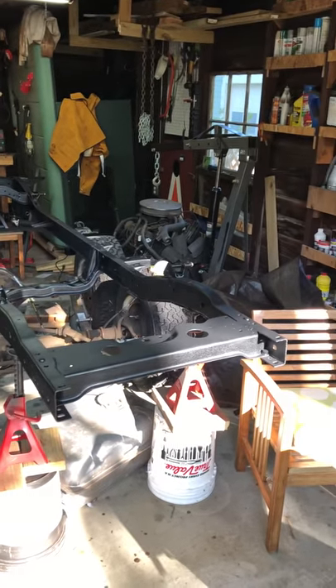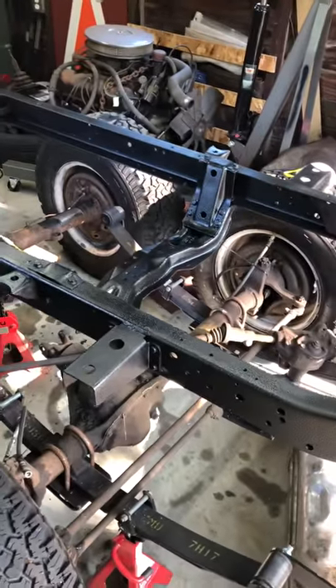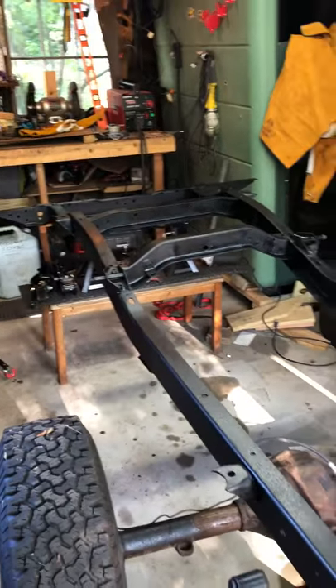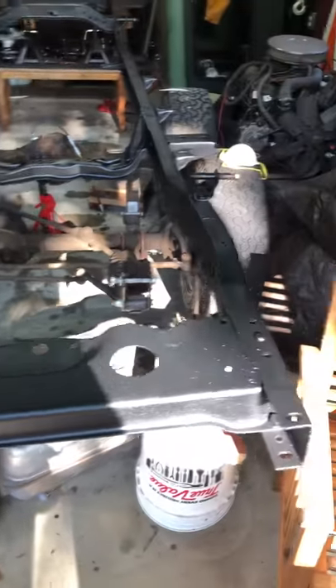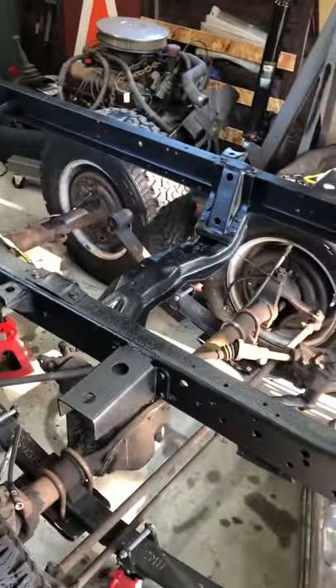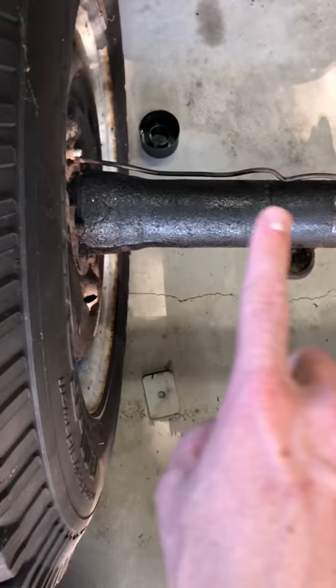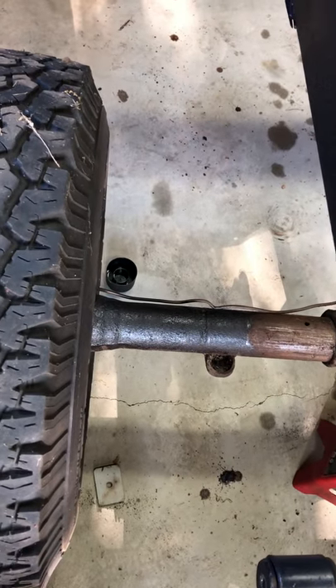Update video on the CJ6 frame — made some considerable progress. The first thing I did was completely coat the frame in a product called CoraSeal. CoraSeal is a rust converter and primer, so it reverses the chemical process of rust and turns the steel into a paintable surface. I didn't take a video of the before, but you can see I put CoraSeal on this axle, and over here I have not hit it with the CoraSeal yet. CoraSeal really takes rust and turns it into a nice flat black surface that you can paint over.